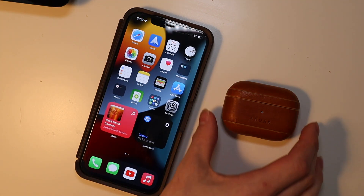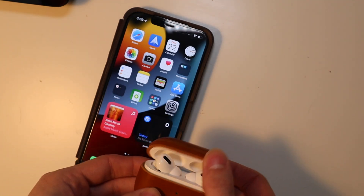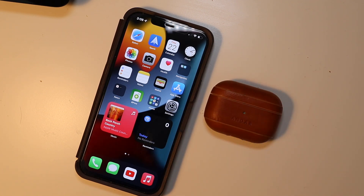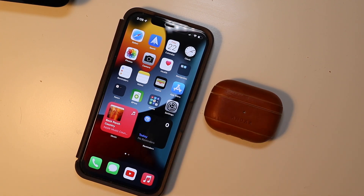And that's all you're going to do. Once your AirPods are charged to 100%, put them next to your iPhone and open the case and let them connect. This may take a couple of tries. There is no real way to manually force an update, but it should automatically install once they are charged to 100%. Apple does say this can take up to 24 hours, so please be patient. Just check on your firmware version in your About section before, and you can see when that changes and you'll know that they've updated.